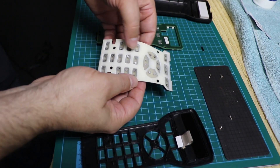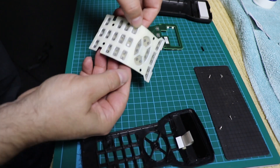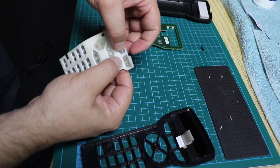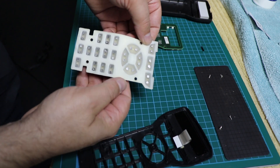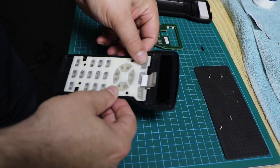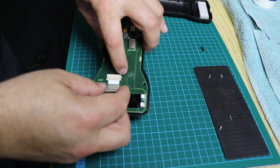Come back the next day, and you can see that there are some little bits of that conductive material that have gone on the white bits of the rubber pad — just a few little bits where we don't want it to be. So we just scrape those off, and then we reassemble in reverse order to what we did to take it apart.